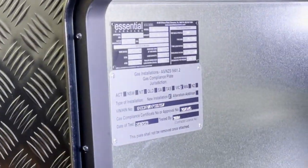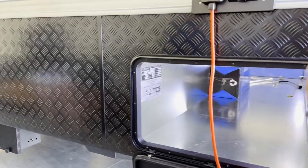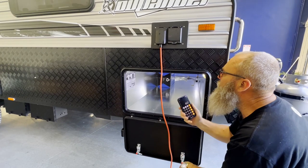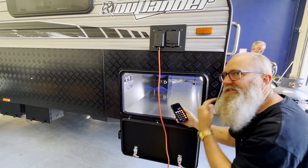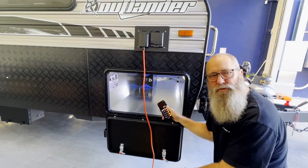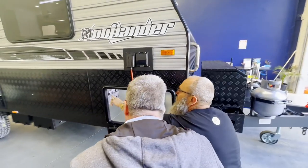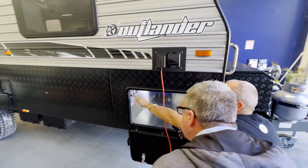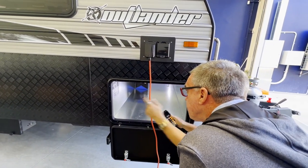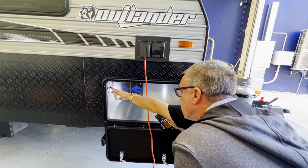So we get your ATM minus the tare weight. So that leaves us with about 441 load capacity. So that's your ATM, it's 2666. And the tare weight is 2225. So that leaves you with 441 kilos of load capacity.